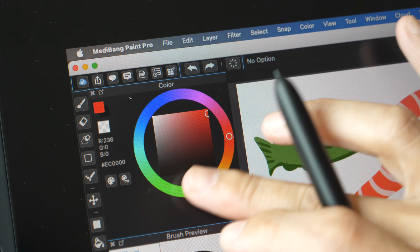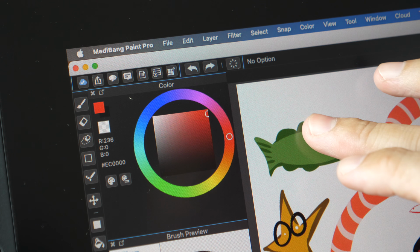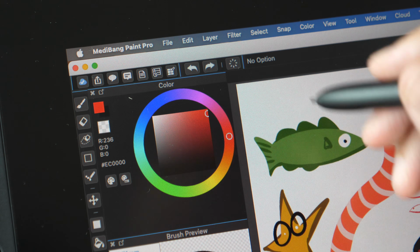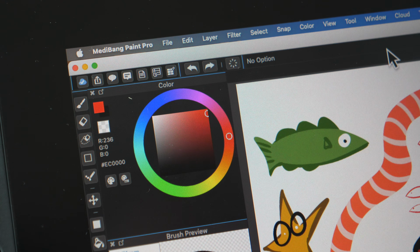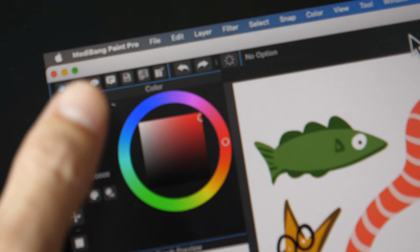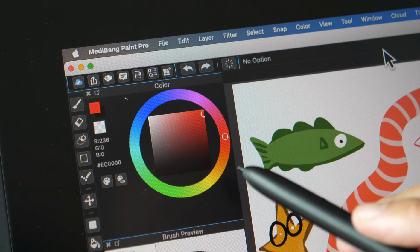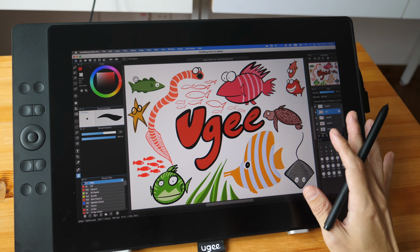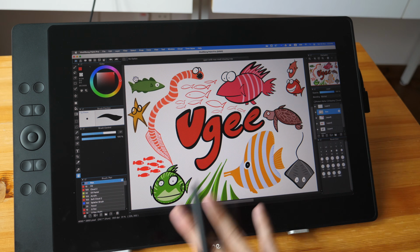Downsides or limitations: this is a matte screen protector, so it may scratch with usage, and I cannot tell you how easy or resistant this is to scratches because I haven't been using this for an extended period of time. Another downside is there is anti-glare sparkle. All matte textured screen protectors will have this grain, color noise, or anti-glare sparkle, and on this display I can see it, but it's not too distracting personally for me. Sharpness is not affected by the matte screen protector, but there will be pixelation from the 1080p resolution.